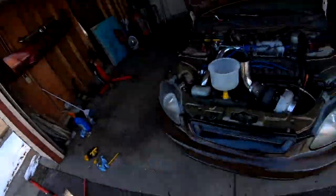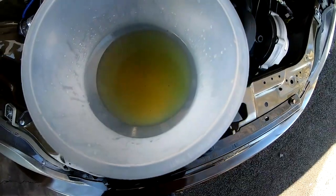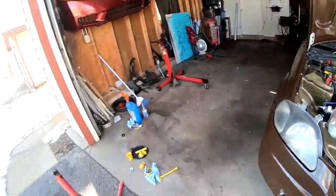So the car has been sitting out here idling for about half an hour, and check this out. You guys see the coolant? It went from being really bright green to having a little bit of a tint, like a darker green. And I can see like little garbage particles that are coming out of the radiator — very, very tiny particles. So let me show you one more time. It also kind of looked like it was a little bit brownish right here, but I think that might be from that other liquid, the pink stuff that I poured in there.